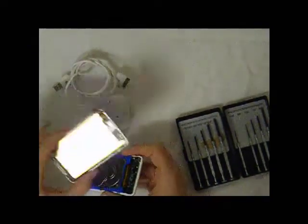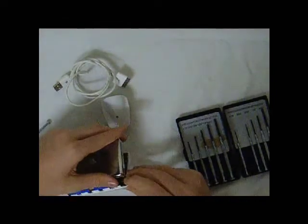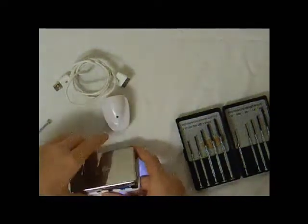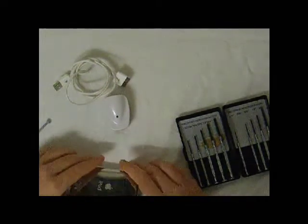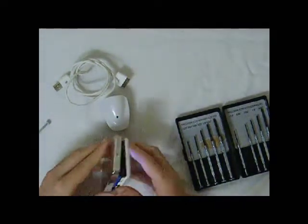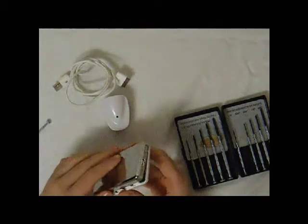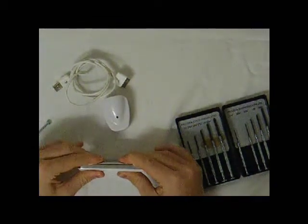Now we're going to take the back and reattach the ribbon cable. It's pretty easy — just put it back on the way you got it off. The screen should probably come on when you do that; that's nothing to worry about. It's just because the hold switch control is on here and it flips when you unplug it. To reattach the case, be very careful — you don't want to put it on straight. You want to shut it like a door. Start on the right side facing the front of your iPod, align it so it looks right, and then on the other side just push it down until it clicks.